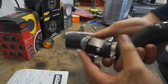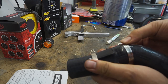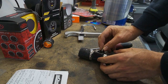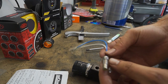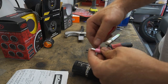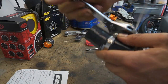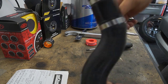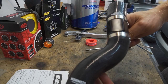I'm going to have the sensor pointing down but I'm going to have the clamps with the screw attachment pointing up so I can easily tighten them in the engine bay if needed. This little bolt is for a ground and we're not using it in this application, so you can either remove it or just tighten it up. Then next we've got our temperature sensor — the same one we saw on the oil sandwich plate. Not too tight because this is an aluminium adapter. When that goes in the car it'll just look clean with the black fitting in the middle.